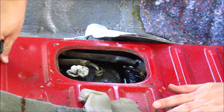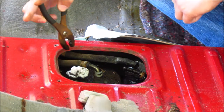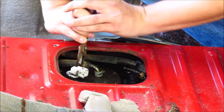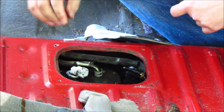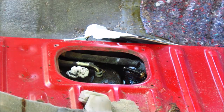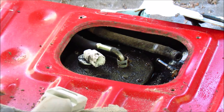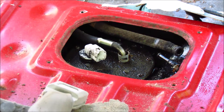We also have our battery disconnected. It would be a smart decision to have a bucket ready — I had no idea there was going to be that much fuel in here. You're going to want to take your time removing this hose; there's a good chance it's going to be super brittle from how old it is. After you're sure you've got no fumes left in the car, make sure to be extra careful. Normally it's recommended to use brass tools so they don't create a spark. I don't have any, so we're just going to try and be real careful.